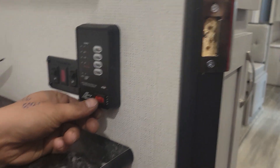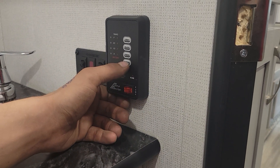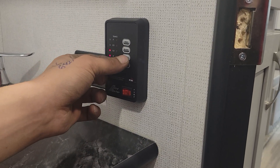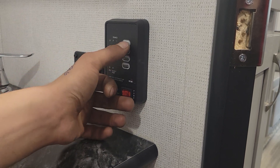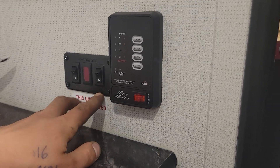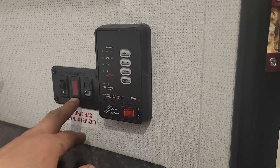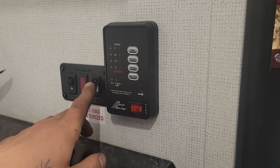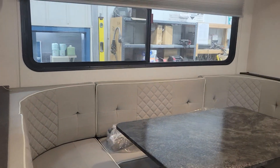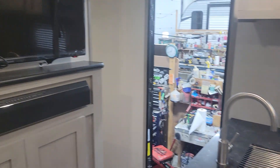The monitor panel here — in the bottom right corner you get your water pump switch. Turn that on and it turns on your water pump, drawing out of your fresh tank to pressurize your lines. The monitor system is above it: battery — you can see we're currently at C for charging; G would be good, F is fair, L is low. Your fresh tank shows a third, two thirds, or full — same for your black and gray tanks. That's also your hot water tank controls: on the left is a little thunderbolt letting you know you're firing it up with electricity; on the right is a little flame for propane. If that check light comes on, it just means it hasn't fired up — turn it off and back on to reset it. You can actually hear the roar of the flame when it's going. That's about it for this unit — if you've got any other questions, please feel free to give us a call at 204-237-7272.